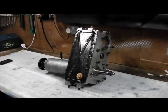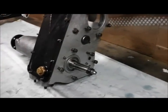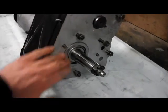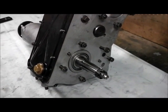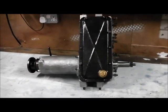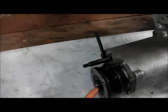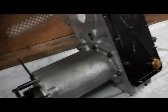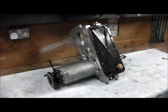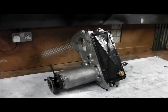We've got to leave it there today — it's getting quite late. The next video will cover shimming up the speedometer drive housing and the back bearing, setting the preload on the output shaft, and any final torquing up that needs to be done. I've got a little gadget for locking the drive flanges so I can torque up the nut. There are a few sealing washers and things to add, so we'll see to all of that. I hope the video has been of interest and thank you for watching.